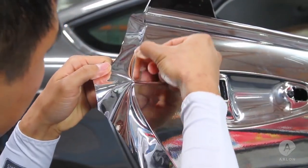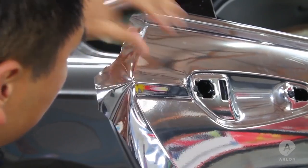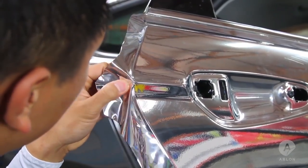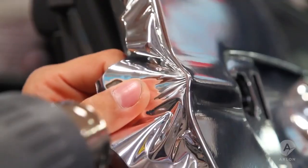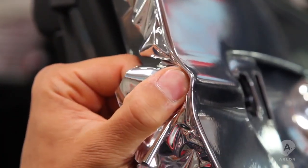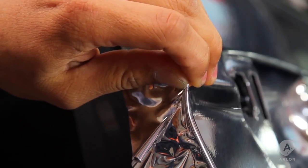Wrapping the edge of a door with chrome is more difficult than with other UPP films because it is less flexible. Begin rolling the chrome around the edge of the door in small increments. Add heat and begin the final roll at the high point of the body line of the door, dividing the tension evenly. When the chrome is rolled all the way around the edge of the door, hold it in place for a few seconds to allow the adhesive to begin to build strength as it cools down.